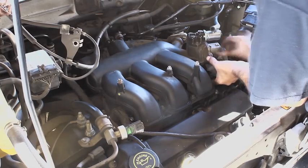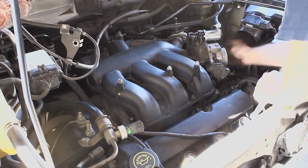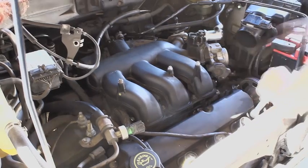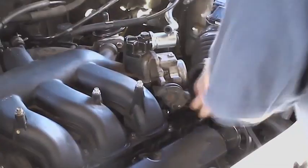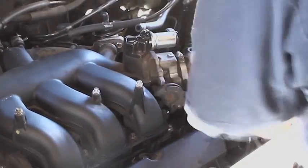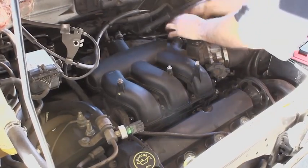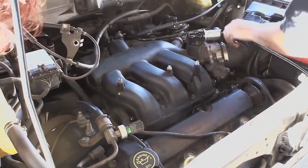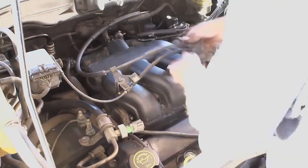Going in a crisscross pattern again for even distribution. The throttle goes back on. I check the actual throttle mechanism right here to make sure that it's not locked up after I bolted it in place. All this stuff began because I had a poor idle. Went to replace the fuel filter — that didn't solve the problem. So I went ahead and upgraded a few components like the EGR valve and IAC valve, emissions hoses, and vacuum lines, and got to this.